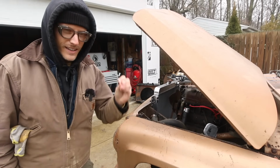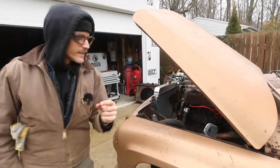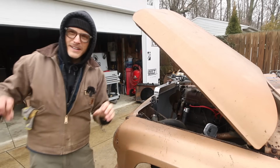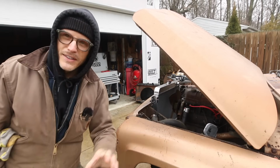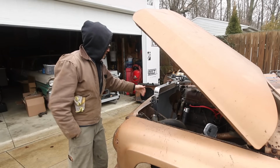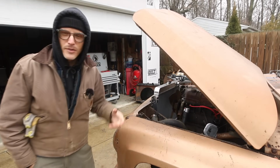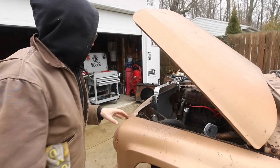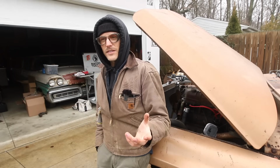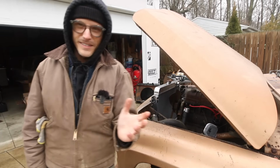I'm having too many things that are requiring, like, if I just did this, I could probably make it work. The hood closes, but it's really tight. I'm hitting the supports up top, so if I just kind of bent up this hood support, it would close all right. The hoses are close, but they're not perfect. So it's like, if I just snug it tight enough, it'll probably be all right. If I cut this aluminum and pull it in, I'm going to be sacrificing one of my welds that are holding it, but I have a spot weld here, so it'll probably be all right. And all those things are just adding up to the point where, yes, I think I could make this work, but is it worth saving $400 and risking ruining this radiator and not being able to return it, so then it costing an extra $180?